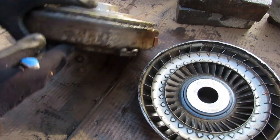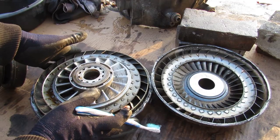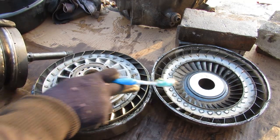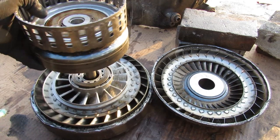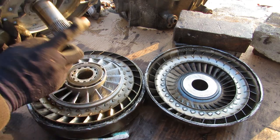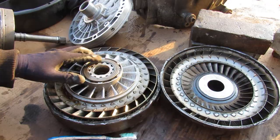On the other side, which connects to the flywheel on the engine, we have the turbine which spins inside of the housing. The outside casing and the torque converter pump are the input to the torque converter and rotate with the engine speed. The output of the torque converter is this turbine, which locks into the input shaft of the transmission. In between the pump and the turbine we have the stator, which locks through these gears to the transmission pump — which is locked to the transmission casing and does not rotate.